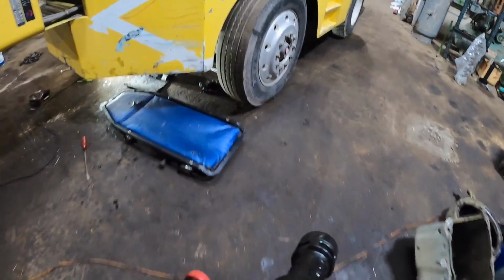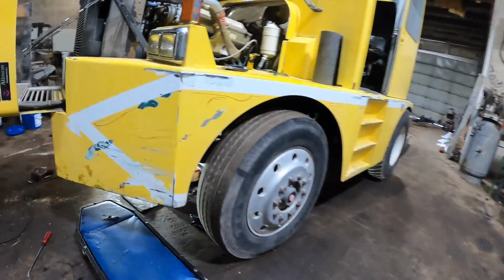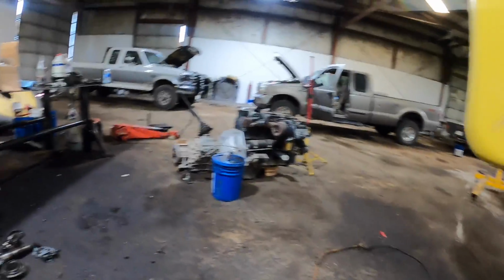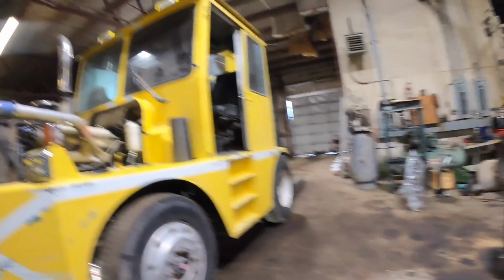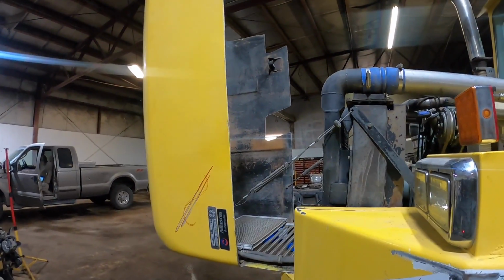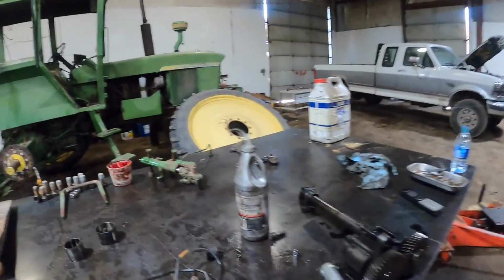I climbed under here. Look at the oil pan. The oil pan was the only thing holding the damn gear on there. All this came as an assembly, and I bolted it on there. See the groove that it wore in the oil pan where the oil drive gear came forward, and that's the only thing that was holding that damn balancer gear on there, was the oil pan. So after I tore the regulators apart, see that those regulators were already on the balancer too.